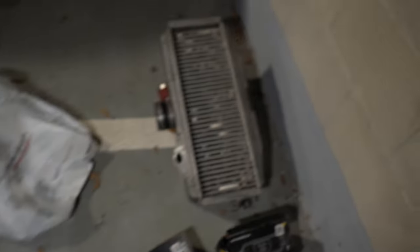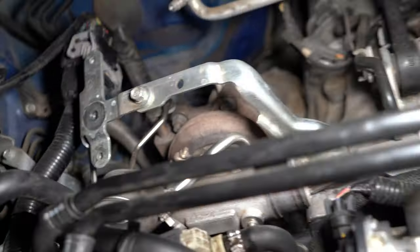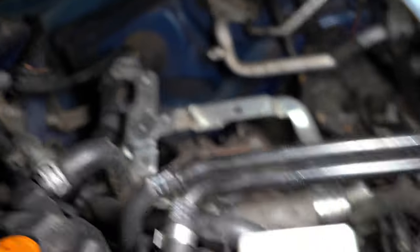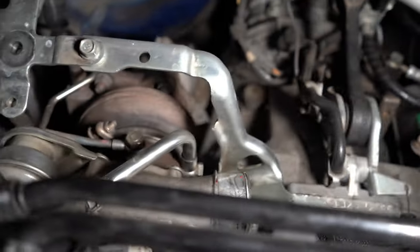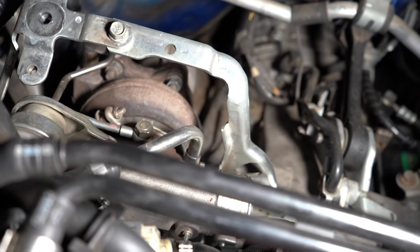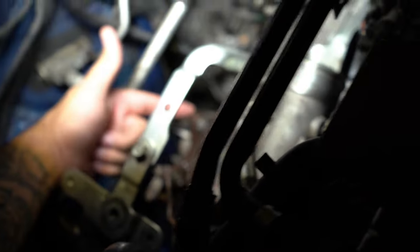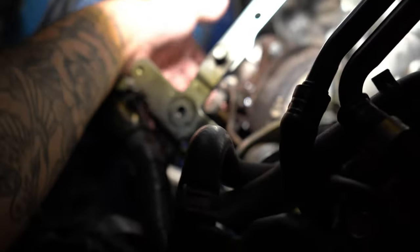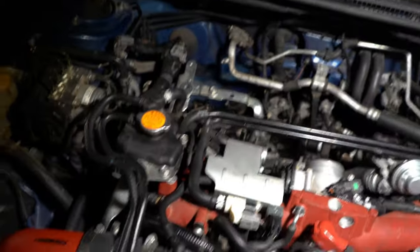As you guys can see, I just wiggled it out — it's right there. You still have this silver bracket right here; I normally just unbolt it just to get better leverage. And then, as you can see, you can now see the downpipe bolts. They're barely ever moved, so that's why I got the PB Blaster. I pretty much put PB Blaster on this bolt, another one right here, one more down here, one directly under, and one more on the side. These are 14mm bolts — five total bolts hold that downpipe. The rest of the stuff you have to get from the bottom.